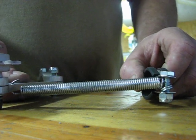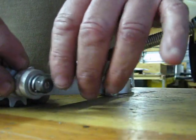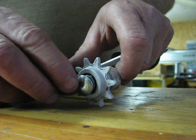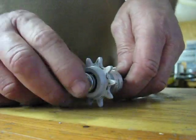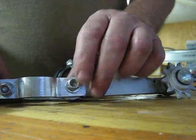These are self-locking nuts on here, so if you go to tighten this up and you see it turning, you might want to grab it right on the head with some locking pliers as you tighten it up. Once it gets pretty snug it'll go on tight. Everything has lock nuts and it's gonna lock down fine.